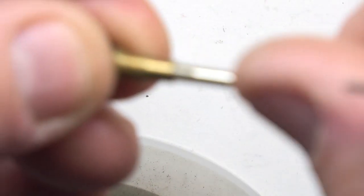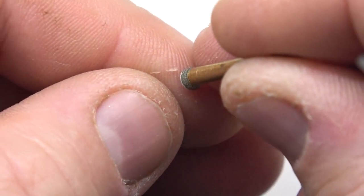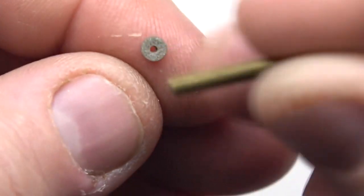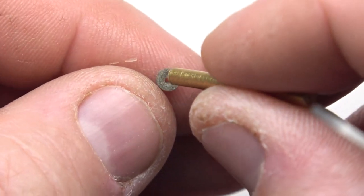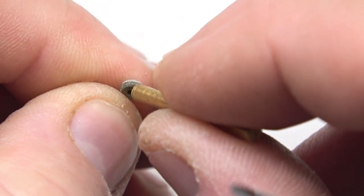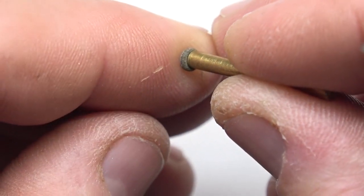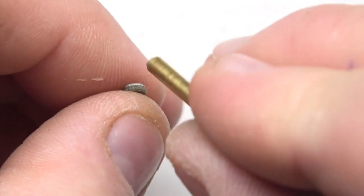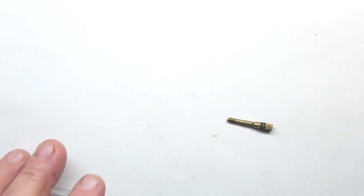You might say, well it's going to let gas through — and yeah, that's the general idea. You're controlling how much gas goes through. Your pin fits down over that hole in the sponge. When you push down on it, even if part of it gets plugged up, you've still got a little hole there. As long as your flame adjustment valve isn't stuck completely, you're still going to get some gas through. That's it on sponges.